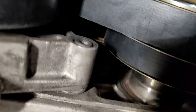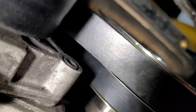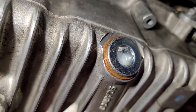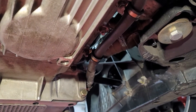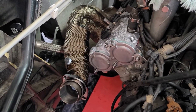I'll need a long extension and a universal joint to reach that upper screw — the one on the other side is a bit of a bear. Once that's done, the only thing left in this area is the cam covers and valve covers. Both timing belt covers are now installed on the cams.